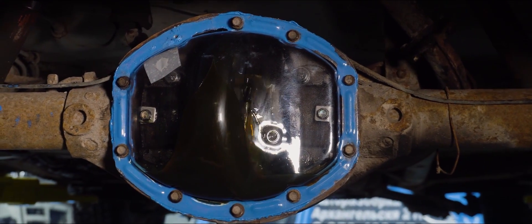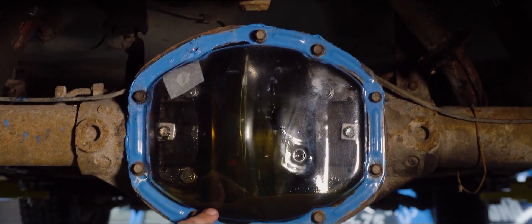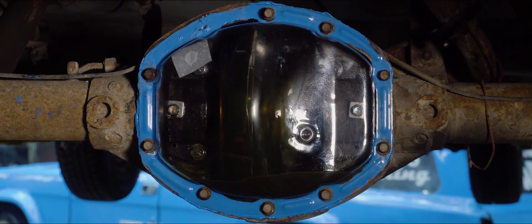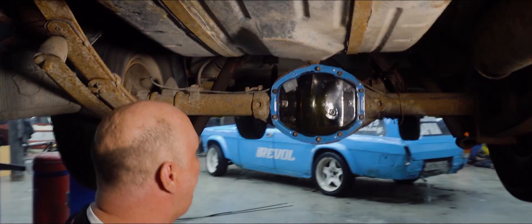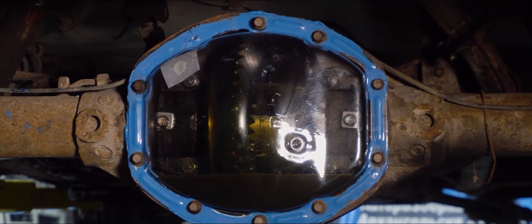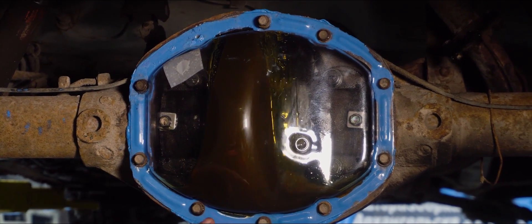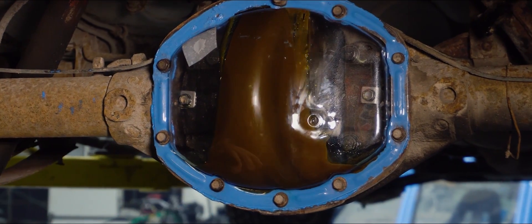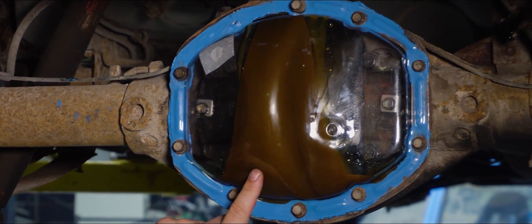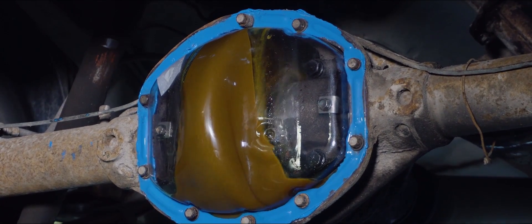In reverse, the oil is splashing the other way now — you can clearly see. Look at how the level dropped off. That isn't even an oil film — that's a stream of oil right there. It's quite substantial. Go ahead and put it into fourth. Look at how it's going. That's fourth gear with the engine literally turning at idle. Oh wow, it's even starting to foam up slightly. You can see it's splashing like crazy, appearing to be ricocheting off the cover.